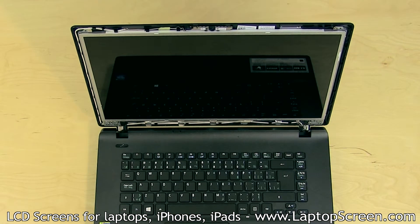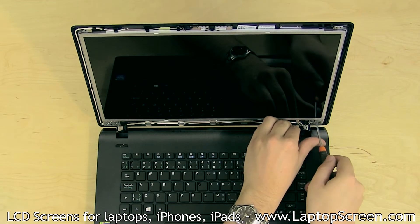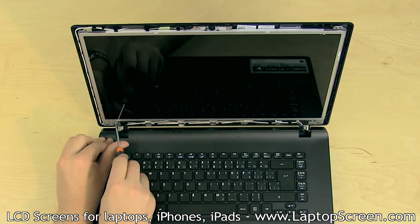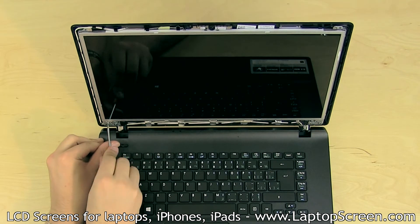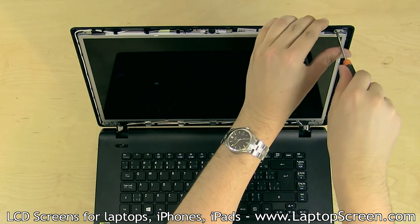The LCD is usually mounted with several tiny screws located on the side of the LCD brackets. Loosen two, sometimes three, screws on each side where the LCD mounting bracket is attached to the hinge to expose the LCD mounting screws. One or two turns of each screw on the bottom of the LCD mounting bracket should provide sufficient access to the tiny LCD side screws. Remove the top LCD mounting bracket screws.